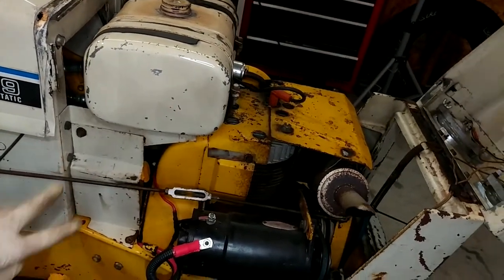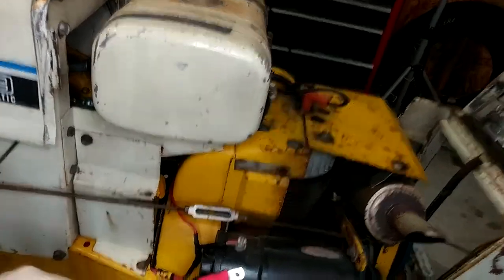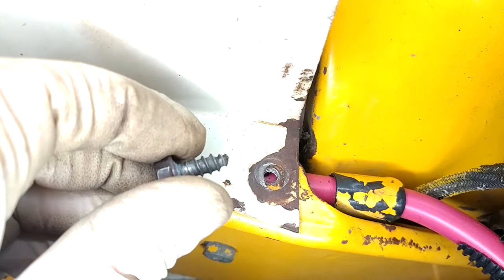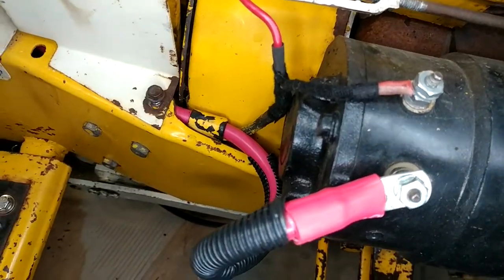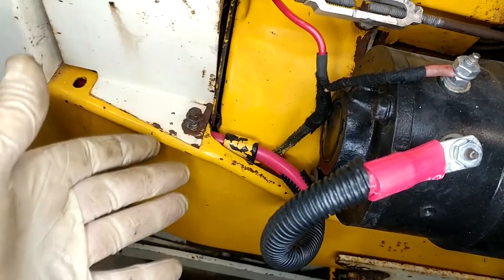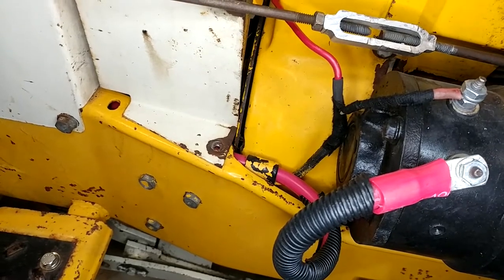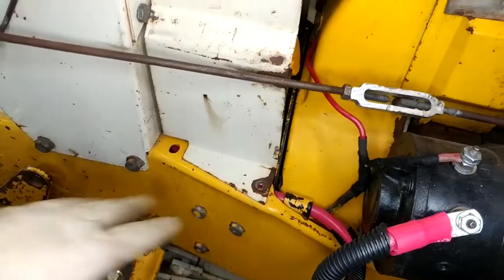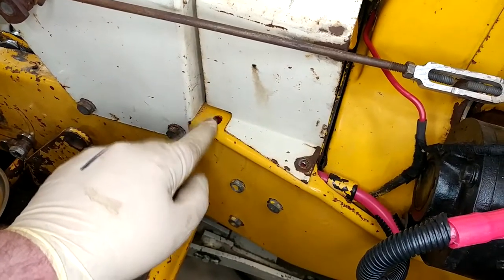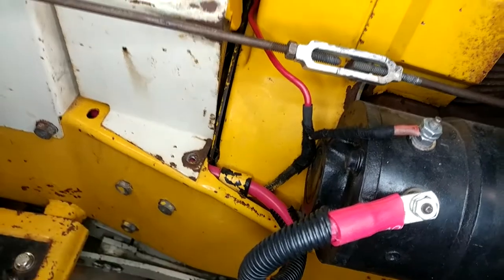I finally hit something I can't work around and still get the result I would have liked, but I can work around it all the same. Got the tower back on, gas tank back on, all that good stuff. This screw that goes in there from the factory is like a self-tapper, and the wire is directly under there — so if I were to install it, there would be a problem. Right about there is as far as I can go without feeling resistance — not even close. What's interesting is this is where the six-gauge wire was, and it was way long enough to have been in the same spot — I have no idea why there wouldn't have been a problem from the factory. Today, we're just not going to put one in there. If this becomes a problem, I could see maybe welding an addition on and getting a fastener in somewhere else, or sinking that self-tapper into a little attachment here — anything but where it is.